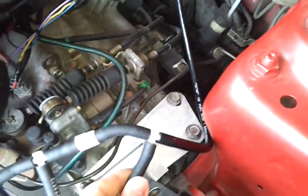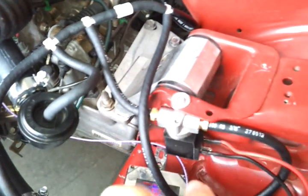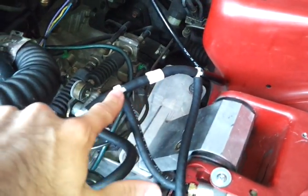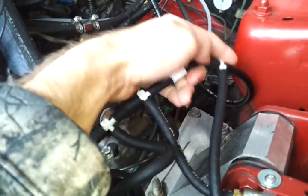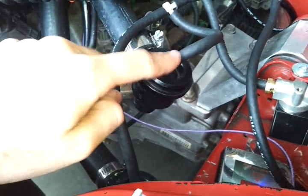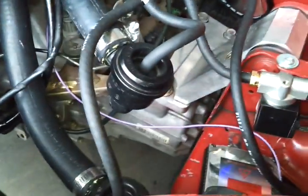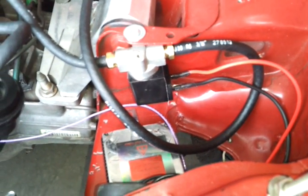Until I have a T right here going to a solenoid. It comes off that T into the solenoid and out below the check valve — normally closed solenoid. Once that solenoid opens up, your boost comes in, back-feeds below the check valve, pressurizes the top of your bypass valve, allowing it to stay closed under boost. And that's all controlled by an external relay fed from the K-Pro.